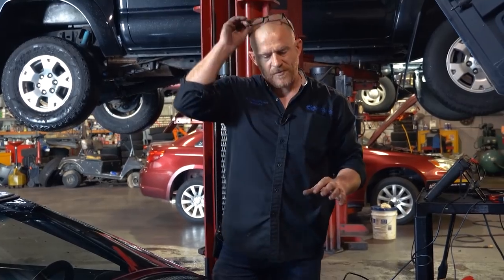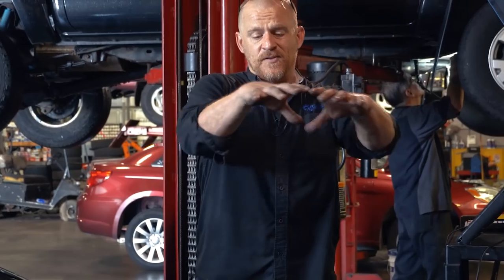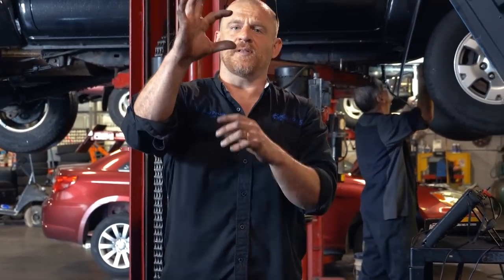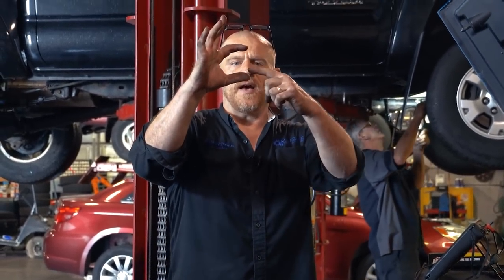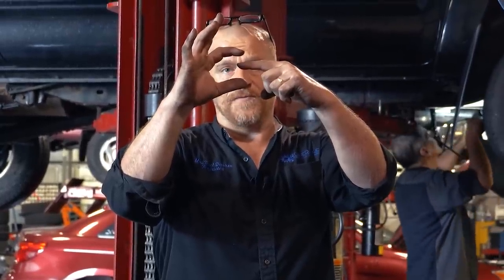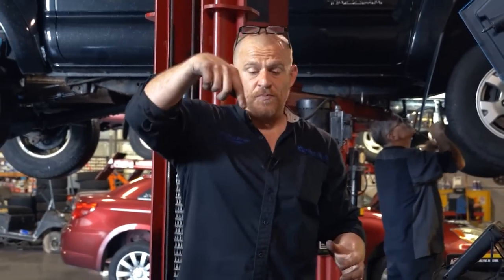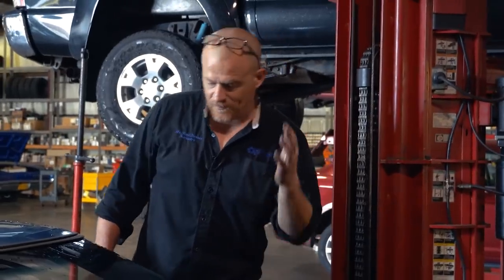I'm a little bit concerned because these injectors are slightly shorter, and so we pulled them out of the rail a little bit. Picture a bore about that long, and then that O-ring can sit anywhere in there and not leak. With the factory injectors, the O-ring is about in the center, and now with the aftermarket O-ring, where the clip grooves are, it's down lower. And so that injector has the potential to push out without those clips. They need to be there. It's important. Safety issue. But you know, they don't make these parts from the factory anymore, and so this is what we got. I'm going to start it.